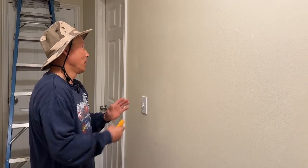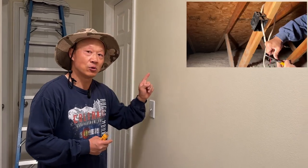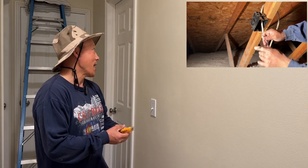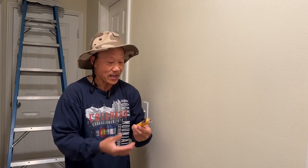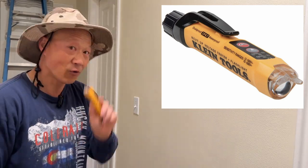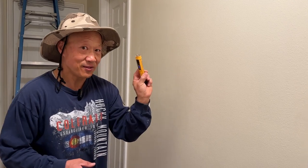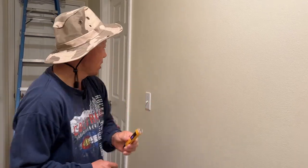In order to find the live wire, the first method I'm going to try: when I looked at the fuse box outside there was a swamp cooler wire, so I'm hoping I can tap into that. But when I went up to the attic and found the swamp cooler wire and pulled it, nothing was connected — no power there. I'm using a voltage tester to find a live wire. If this method doesn't work, I'll add a new wire from the fuse box.